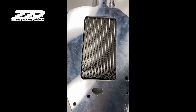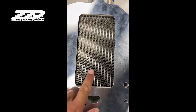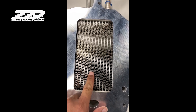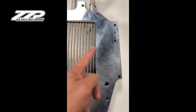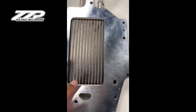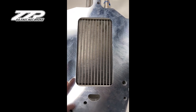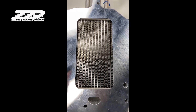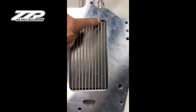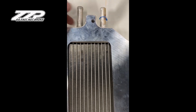On the old unit, in the core — which is where the majority of the changes were made — we had seven millimeters between the water channels. We had quite a large core that is six inches wide inside. We thought previously that the air would travel around the entire core and that would cool it. But what we learned after running them for a long time is that the bulk of your cooling is happening right there, right at the supercharger outlet. This also brings up a weakness in this design.